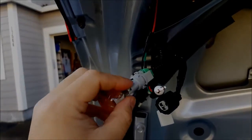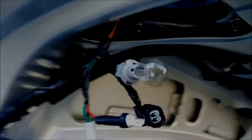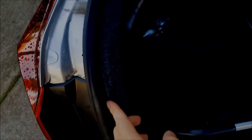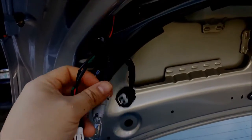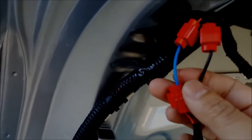I found out that the regular housing is the one for the reverse tail lights. There was a cover and I removed it, so this is just going to go into the tail light. You're actually using the OEM bulb for reverse, but the problem is the wire doesn't reach — there's no way to screw that on, so I'll probably have to cut it and extend the wire. It looks like it's actually plug-and-play — the OEM bulb fits directly into the housing. With the inner tail lights it's pretty easy as well: this plugs into the OEM harness, the bulb plugs in, and the reverse tail lights plug into the housing — you just have to extend the wire and you should be set.